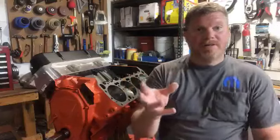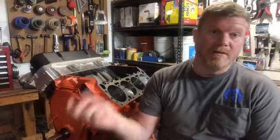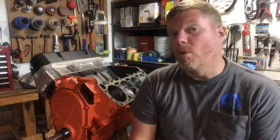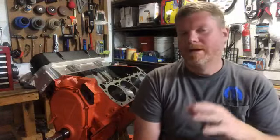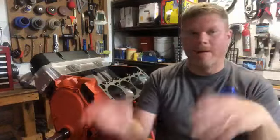And that's why they adjust two major things when it comes to a supercharged engine. They adjust ignition timing and the heat of the spark plug and the compression, all right? That's why you see a lower compression ratio on a supercharged engine than on a naturally aspirated engine, because the supercharger is doing so much more of the work. So if you're messing with that kind of stuff, if you're going down the rabbit hole, and you're like, hey, listen, I'm going to put a big turbo on it, or I'm going to put twin turbos, or I'm going to, blah, blah, change the supercharger wheel.